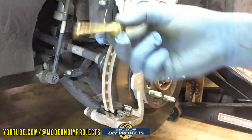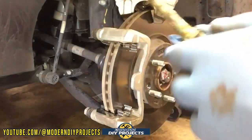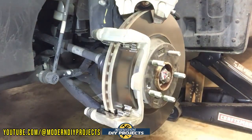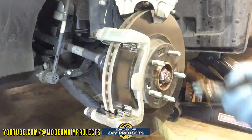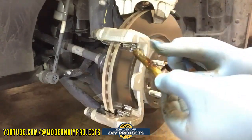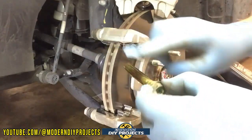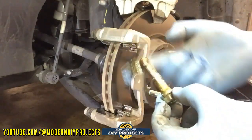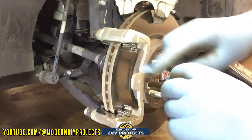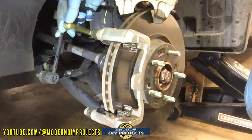Actually it doesn't look all that bad — it looks perfectly fine. I don't know why it was hanging up a tiny bit, but I'll just add a little bit of grease to it. Just a little dab of general purpose grease — the one I'm using is actually for brakes, but you can use any kind. I suggest using grease for brakes and bearings — that'll be a whole lot better. Not too much, you don't want to overdo it, because then it'll get packed in there and may give you trouble.